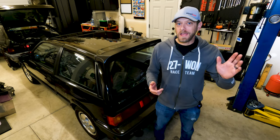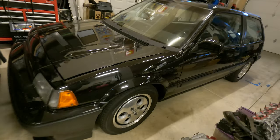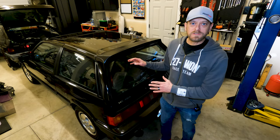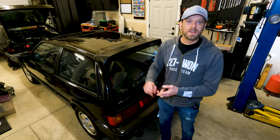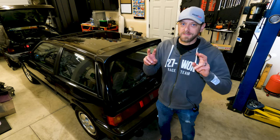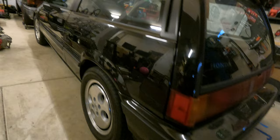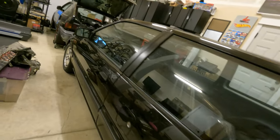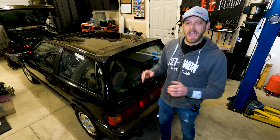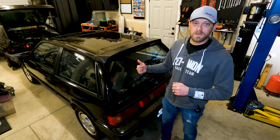Well today, it's pretty rainy outside so we won't be going out there to do anything fun, but we've got this 1987 Civic hatchback in the garage. One thing about these cars is they've got a really unique suspension system — they've got torsion bars in the front with struts, and in the back they've got a beam axle with a funky linkage arrangement and a semi-independent rear end. These cars are getting more and more popular to modify, but a lot of folks familiar with golden era Hondas from the 90s are a little thrown off when it comes to the 86-87 Si's — actually the whole 84-87 generation of Civic chassis. So we're going to show you underneath this car and give you a good look.